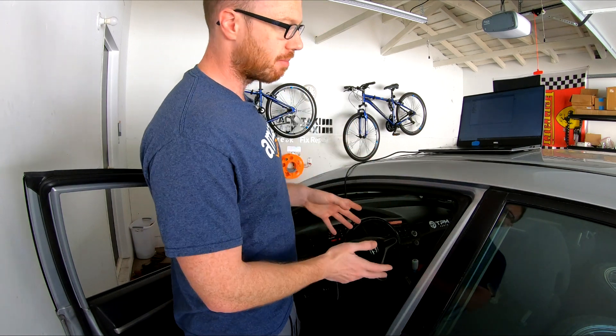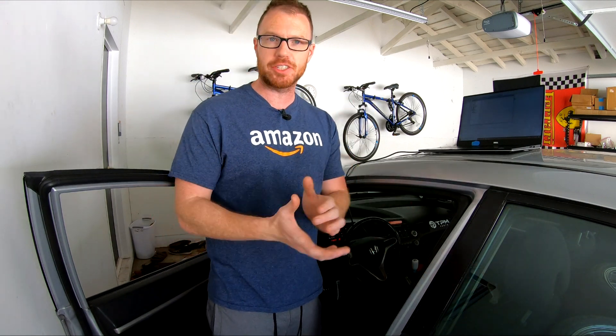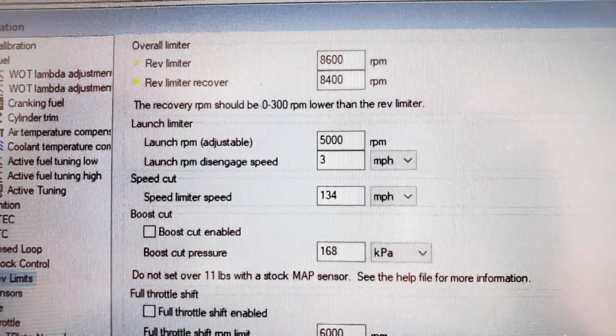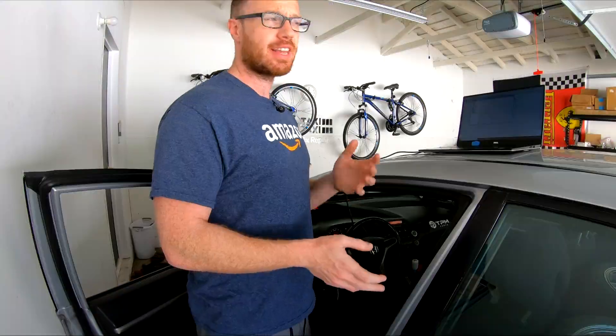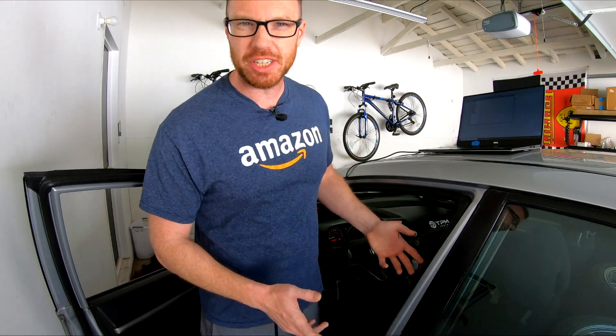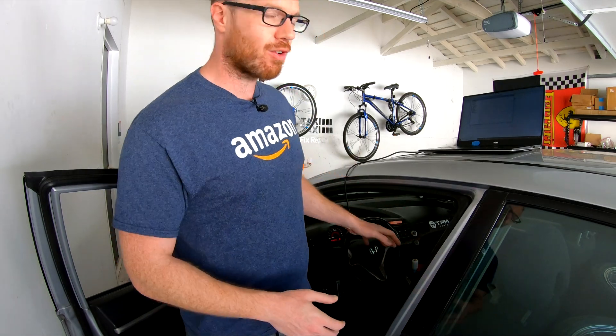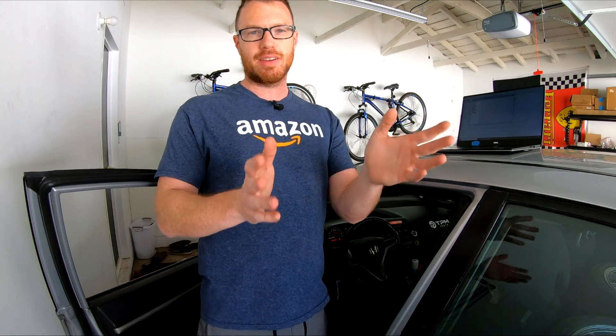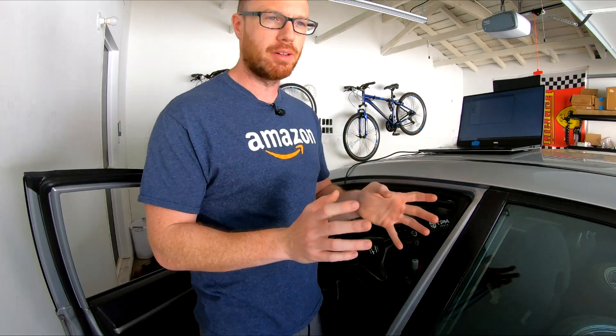Instead, the real gains in terms of drivability come from the revving of the engine. First up, redline is bumped to 8,600 RPM from 8,300 RPM, which is really, really nice. It gives you that extra bit of pulling power in each gear. So in a certain track scenario where I might be right on the limiter of second gear and kind of bog into third, that gives you that little bit of extra usability room.